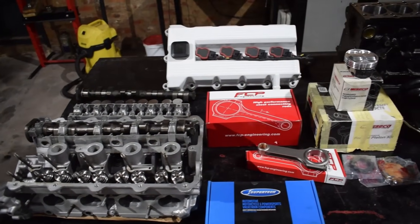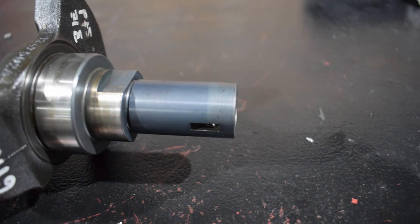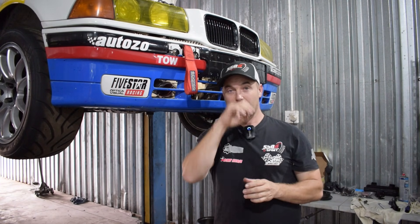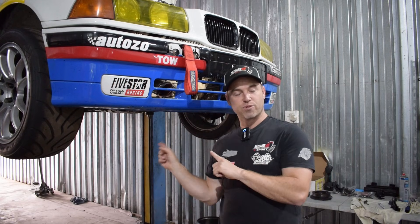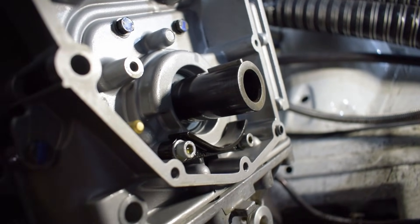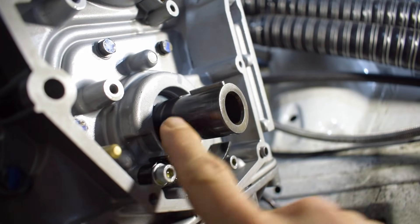This year in 2025 we're taking it to the next level. In the last few episodes I've received quite a few comments around what we did on the nose of the 320 diesel M47 crank. The M44, M42, and M47 cranks are very similar, however the front part of the crank — the nose — is slightly different, and there are a few mods you have to do to make the M47 crank work on this motor. Let me run through how I got around it. What we're talking about is the nose of the crank, the snout, and that is essentially this — the chain sprocket fits on here as well as the dynamic balancer.